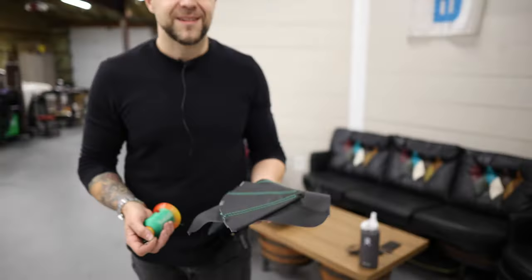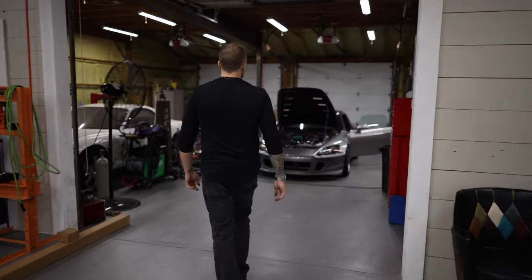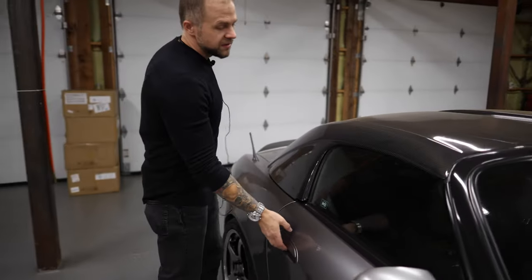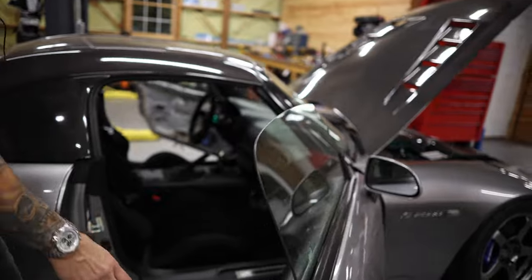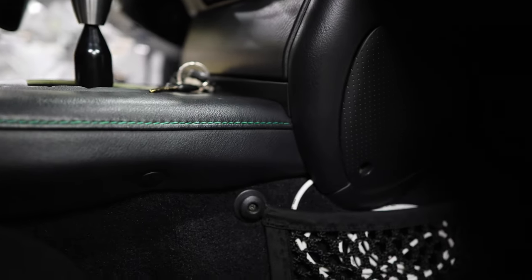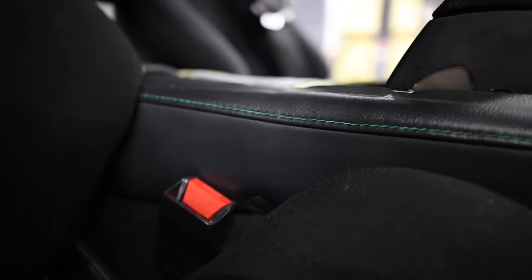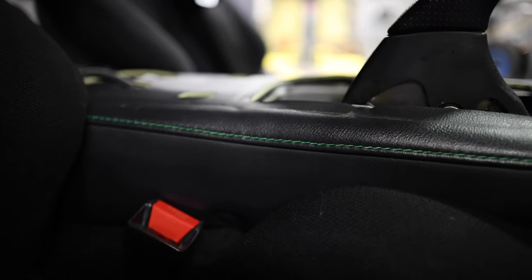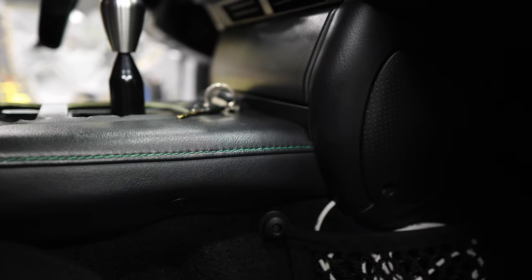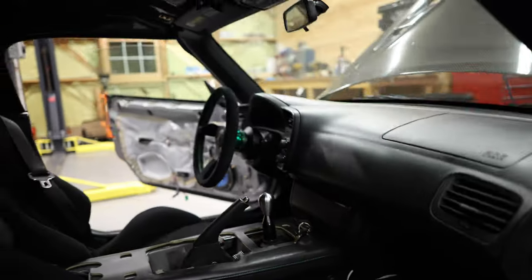Some of you may say this is a little bit cheesy, but I stitched the whole center console in my AP1 S2000 using that method. You could probably do this with the OEM door panel inserts too. I went right down the OEM stitch line, and when you do this method it just eats up the black — it's pretty much hidden underneath the stitching. But it gives the look of contrast stitching without having to do a custom wrap and rip everything out. Custom wraps are a lot of them glue-on, and it's a monumental pain in the ass — it takes a lot of time and patience.